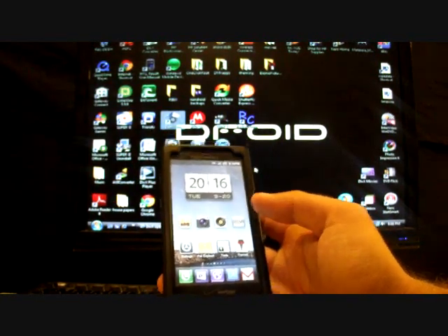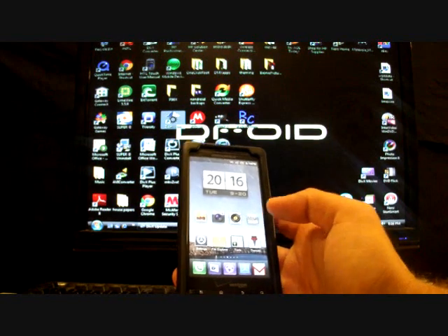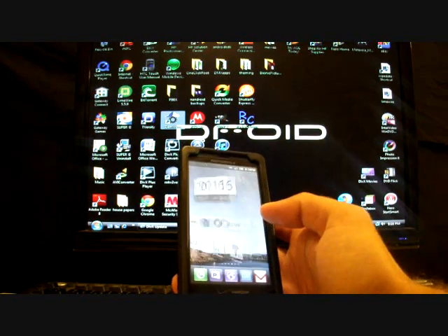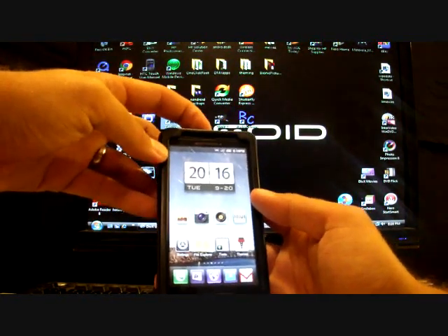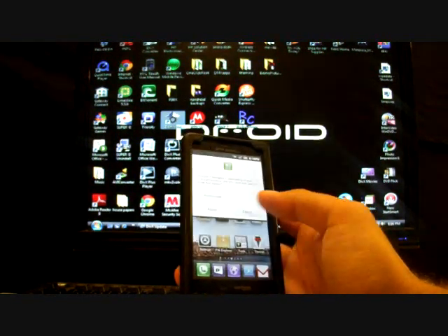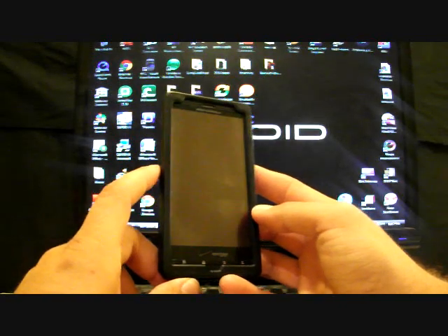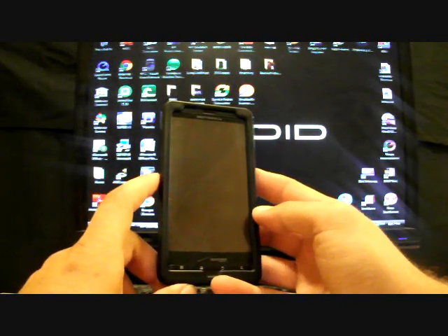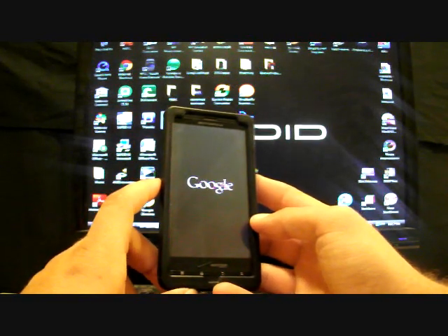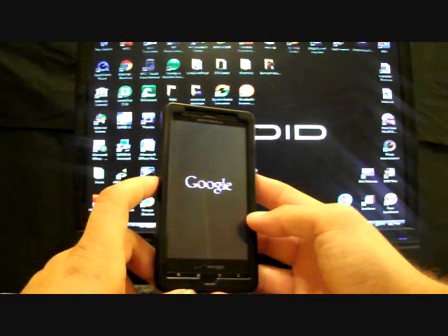You need to be on Gingerbread, you need to be rooted, and if you're coming from a stock ROM you'll need to boot into recovery via Droid to Bootstrapper. If you're on CM7 for Gingerbread then you can get there from their custom recovery. I already have it booted, so to get into ClockworkMod I'm going to press and hold power, select reboot, then ClockworkMod recovery and allow. If you've already installed ROMs on your phone and you're familiar with the process, you can skip to my quick review.